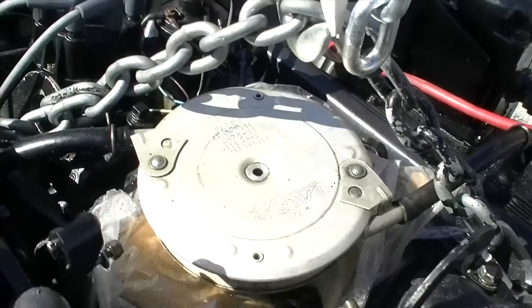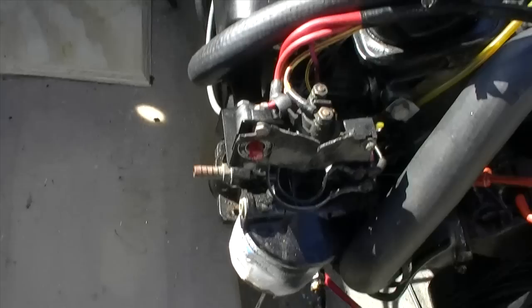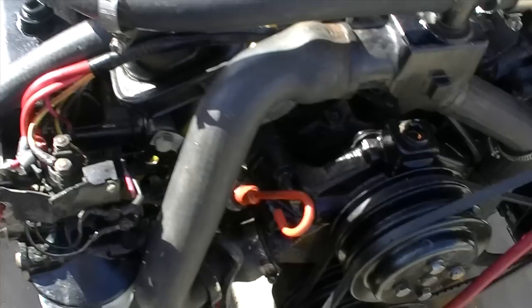And then we're using the engine hoist to give us our front adjustment, just like you would with these motor mounts down here. We ran the alignment bar in and out, got it fairly happy where it needs to be. So we're gonna measure now. And also make sure that nothing's interfering with our trim pump and our battery tray.